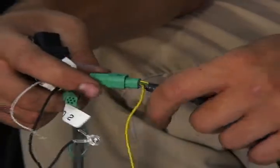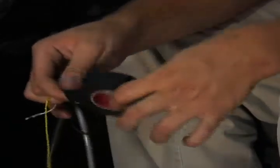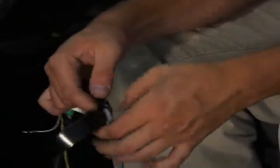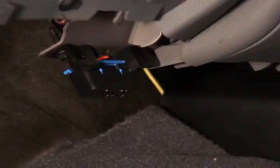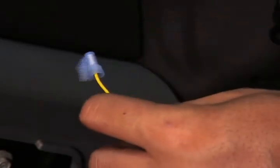Plug the Outlook cable into the OBD2 cable — there is only one way to connect the plugs. Use electrical tape to cover any exposed connections. Now plug the OBD2 cable into the truck's OBD2 port and install the connector to the yellow lead.